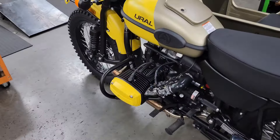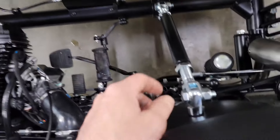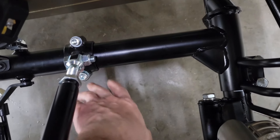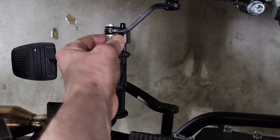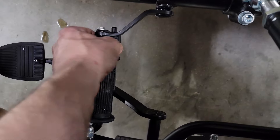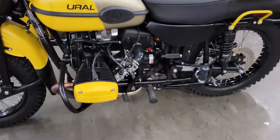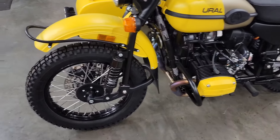A few notes during assembly: if you guys have bought a bike from somebody else not from our dealership, on the newer models things you may want to go back and check. Common things that are left loose — the top end or bottom can be left loose. A lot of dealers forget to tighten this clamp down; this is a new design from last year. They also forget to fold the cotter pin around — we always fold both sides around so your pin doesn't hop out. We've sold a number of these clevis units over the years where customers have lost a pin. Yes, I dripped oil on the floor when I swapped the valve cover, so it's not leaking. Of course the valve covers will be back off when the unit has its first service at 300 miles, where it will get a head torque and valve adjustment.